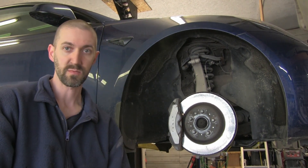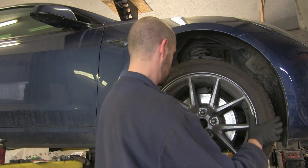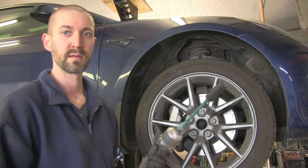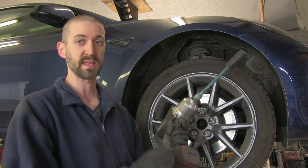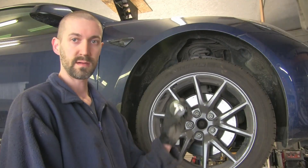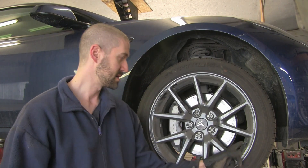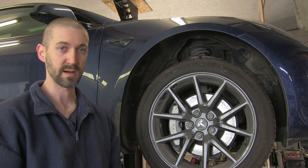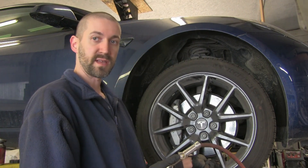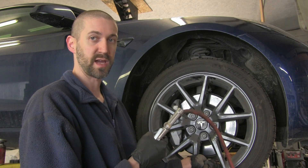Okay, so now I'm ready to put the summer tire on. I've taken the right rear because we do a tire rotation when we're changing the tires over. Just put them on hand tight. When using an impact gun I'd highly recommend a torque stick — that way you won't over-tighten the wheels before you torque them on the ground. We've got these nice little T's that we can put on in the center. I like to line the T up with the TPMS sensor. Just smack it in. These are Bluetooth TPMS sensors so they will self-program when we get in the car. We'll set the tire pressures before we move on to the next one. That's a fairly heavy car so we set these to 42 PSI — always take your gauge and put it over the reading and let the air pressure out so that it stabilizes on its way down.